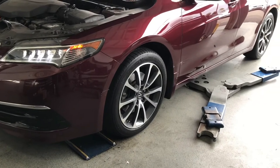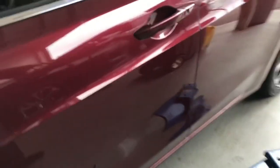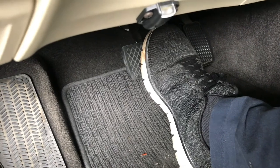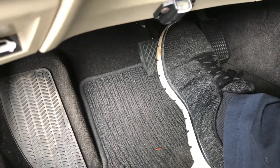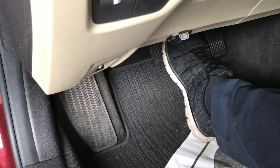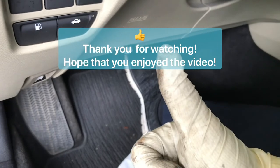That's how you replace the front brake pads on the Acura TLX. The brake pad replacement is done. Put the wheel back on the vehicle, lower the car, and torque everything down tight. With the engine off, pump the brake pedal about 4 to 5 times. After pumping, the brake pedal should be firm, which means the piston is fully extended against the brake pad and fully seated. Start the engine — you'll see the brake pedal slowly sink down, but it shouldn't sink all the way to the floor, which tells you the brake system is good and there's no air in it. Go test drive the car and make sure it stops safely. Good job, guys! Thank you for watching — have a wonderful day and don't forget to give a thumbs up!